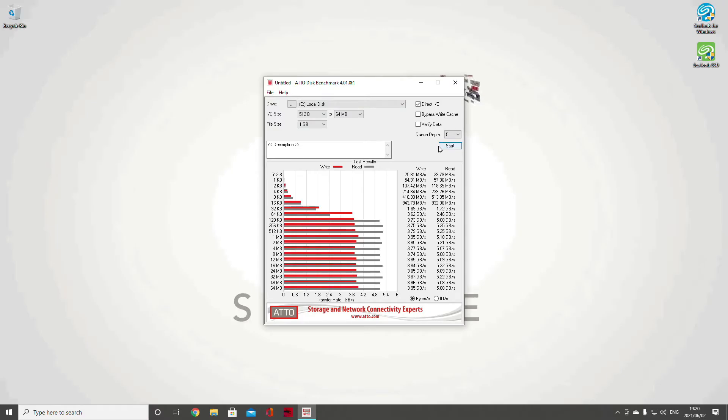ATTO is done and we can see phenomenal performance. With smaller sample sizes speeds are lower, but we start to see really consistent write speeds. We couldn't quite hit 4.4 GB/s, though in Crystal DiskMark we hit around 4.265 — and we're actually seeing over-performance on the read side. This tells me the drive is performing as promised and is a monster that can handle anything thrown at it.